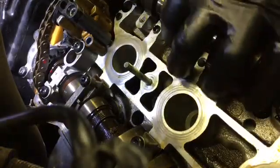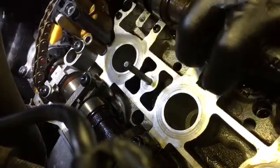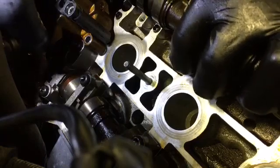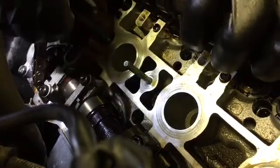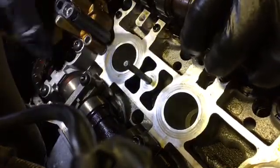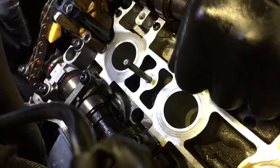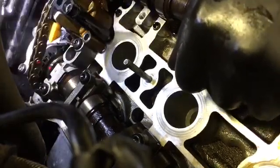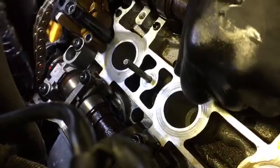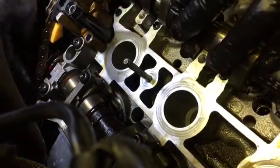There's no real good way for me to show you how to do this, but now that I've got everything off, I'm going to pick this intake cam up carefully without moving the chain off it. I'm going to rotate the chain on the exhaust side — it's not always real easy to do but it can be done. I'm getting enough slack so it jumps, actually moving the intake cam down while trying to rotate it at the same time. There it is. Take your time because you don't want to go too far.